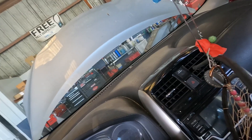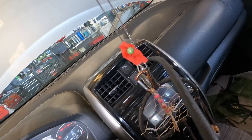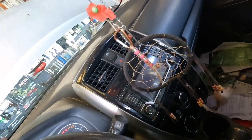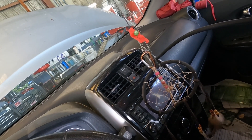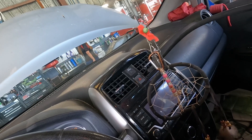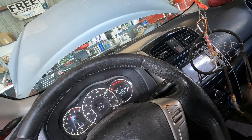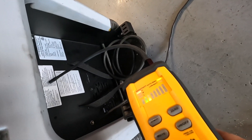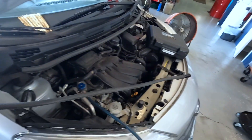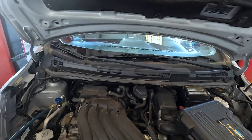Got the Field Piece refrigerant sniffer — hold the on button, let the lights do a dance, takes about a minute and a half to boot up. Going towards the evaporator first, then quickly around these hoses. Not picking up anything yet. Might have to go down by the drain — usually it'll come out of the dash if there's a leak, especially with the system off so the pressure is higher on the low side. The evaporator is on the low side so you might have 90-100 PSI to show a leak. I'd like to tell you I found a leak but everything comes up clean — I'll let them know up front and find out the real history on this car.